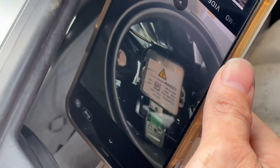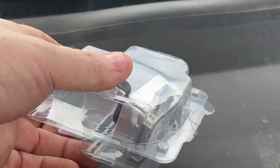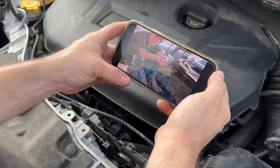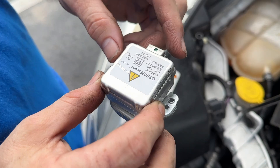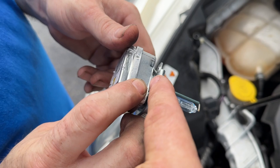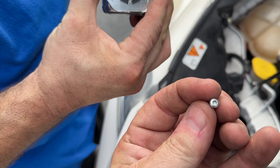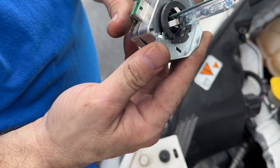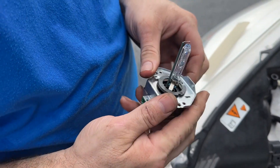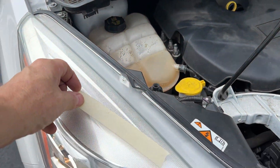It looks the same on both sides but it also moves a little bit. I'm thinking it probably twists — I bet there's some simple solution to this that I just do not see right now. I think the other shop just grabbed it with some pliers and started to twist around, and then realized it doesn't come out. It has two teeny little T-10 screws that are really tough to get to. That little retainer bracket goes around the bulb — looks like it just slides up and down.